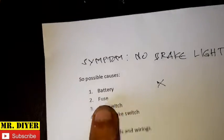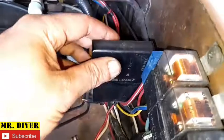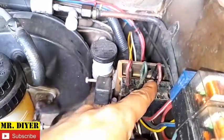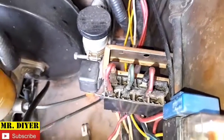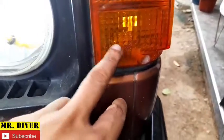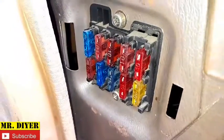Now let's move on to the fuse. We have one main fuse here for the headlamp, and another series of fuses. Let's turn this on — we have this light working, the headlight working, and the taillight working. If we disconnect this, that turns off. Connect it again and it turns on. So now we're sure there's no problem with this fuse.